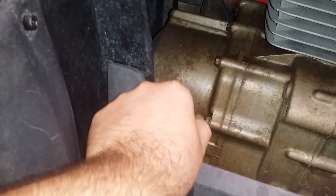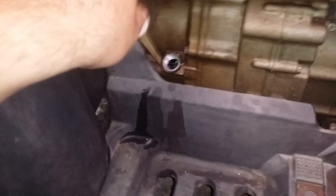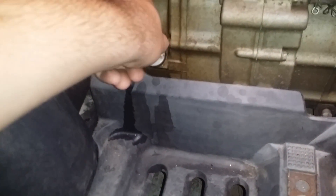It's only about two weeks old, which I've been using as the break-in oil. But as you can see, it's not very pleasant looking. See how it's milky colored? That's because it's got water in it still. Should have seen it when I pulled it out the first time.